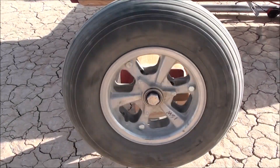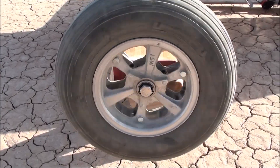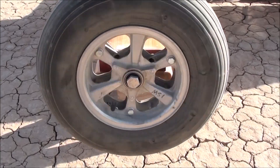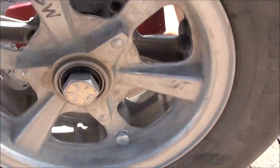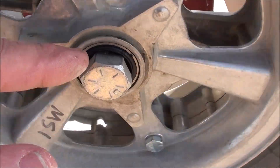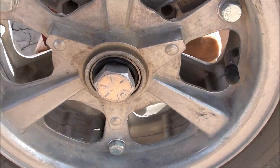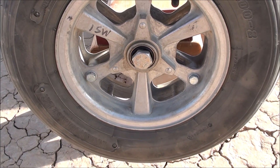As you can see, those are pretty free-spinning bearings — not too bad. Another problem I've had is packing them with grease; you can see the grease coming out right here. I might have put too much in, but the seals don't hold grease great, so that's why you have to check them often.